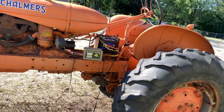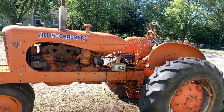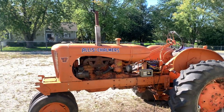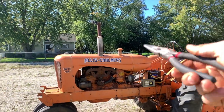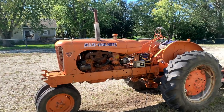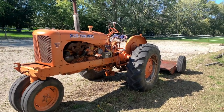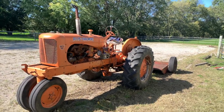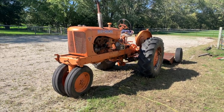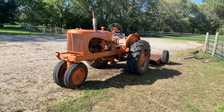I got one really good attempt and it fired up, then was running for about a minute and then died. Not sure why — could be water in it since it's been sitting and raining a ton. When it did run, water was spraying out of the stack until it stopped, and then it ran just a little longer and shut off. Now the battery is so weak it's not letting me try to start it again. Starting and then turning off without really moving doesn't give the battery much time to maintain a charge, so we'll have to let it sit and charge up.